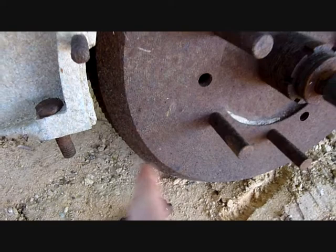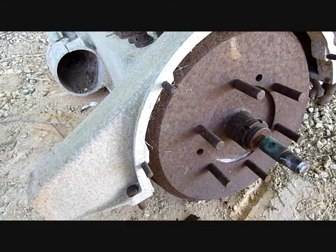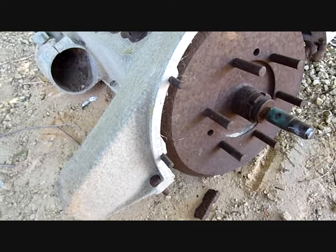But oh, good for a few parts, possibly. It's got the light flywheel, which is also on the 501S. And you can see it's got the chamfer on the end of the flywheel, so, you know, in theory it's lighter, so it'll be able to spin faster, the engine won't have to work as hard to spin the flywheel, and hence it'll give you better acceleration. But the downside of that is when you're trying to go up a hill, you won't have as much torque, so it'll be slower uphill, you have to change back a gear or whatever.